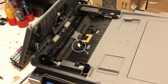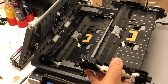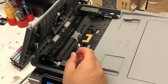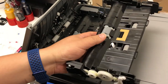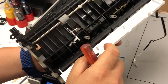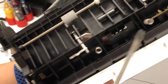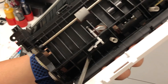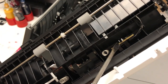This piece has nothing to do with it. For the printer to think there is a paper jam, you have to have some electronic sensors. This part looks like it has a sensor lever, but if you take an ADF and open it up, you'll find that the sensor is on this part. This piece just controls that one paper has to be completely removed before the next paper can fit into the ADF.